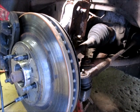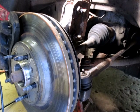We did the brakes and replaced the front hub assembly on this car not that long ago. It could have been then that I did something wrong and pinched that boot, put a little tear in it. I can't see how else it would have got that small hole in it, but it still needs to be fixed, so that's what we're going to do. Looks like a fairly straightforward job.